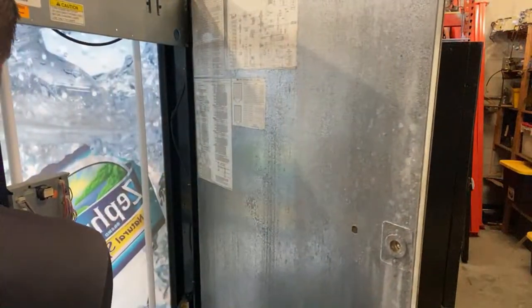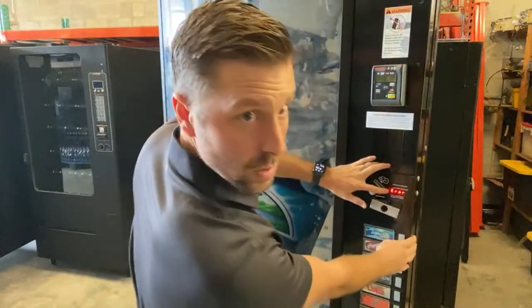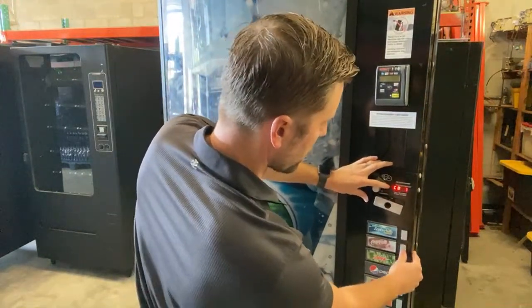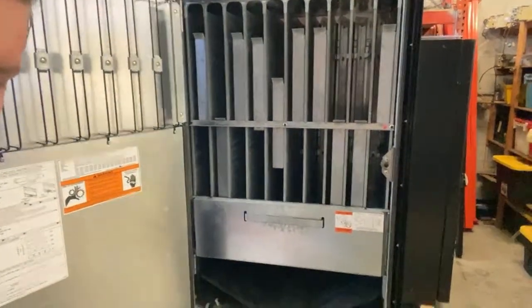We're gonna put the machine in test mode. Right here, we're gonna scroll. You can see it's on air. We're gonna scroll till it says test, enter, vend, column 1, enter. Now it should be.